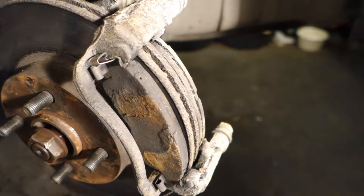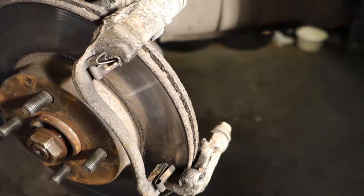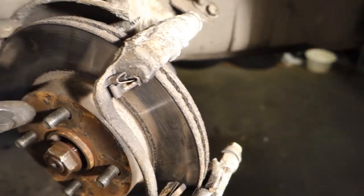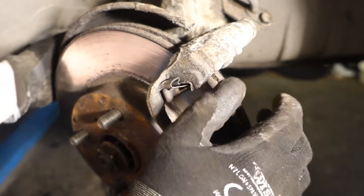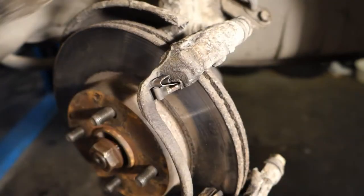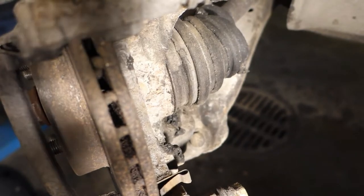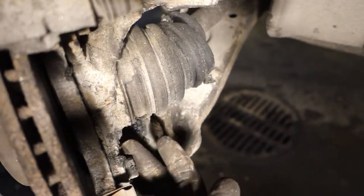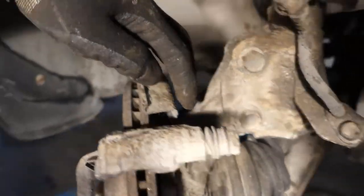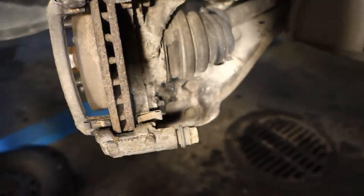And then I take these brake pads away. And then this brake disc is moving, and then I think that I need to take this brake caliper support frame, this part, away next. And there are two bolts. First is in here, and second is in here, in that area. And I need to open. Here is the second, and its size looks like 17 or 19.